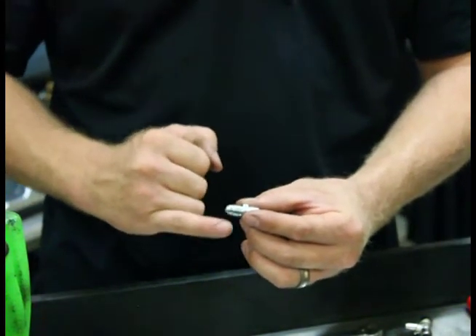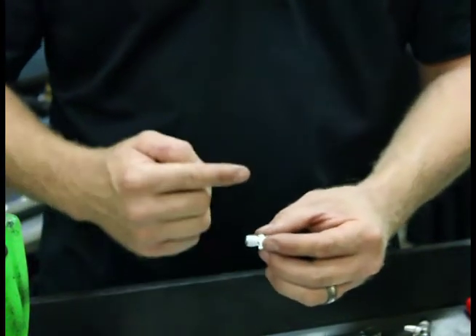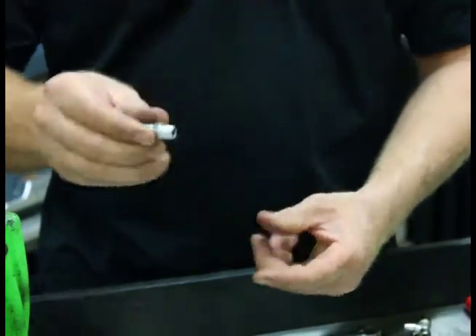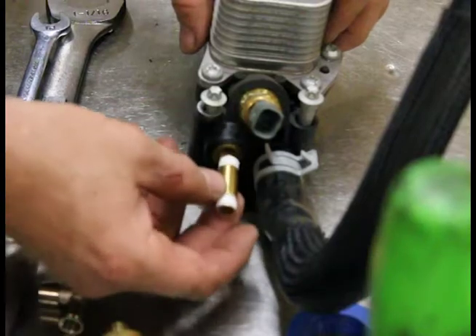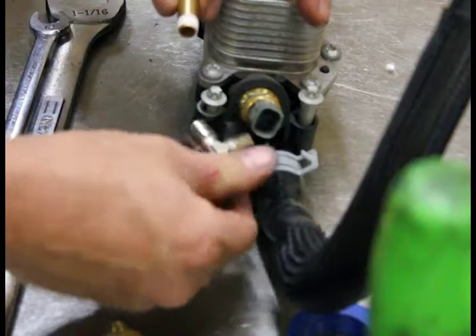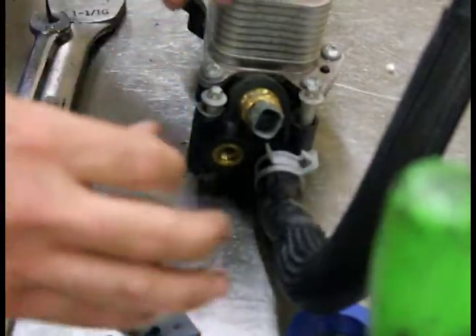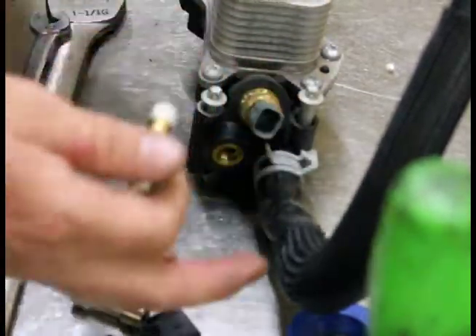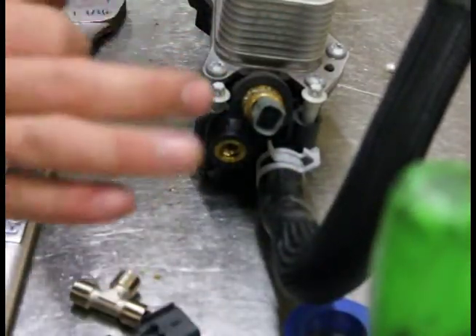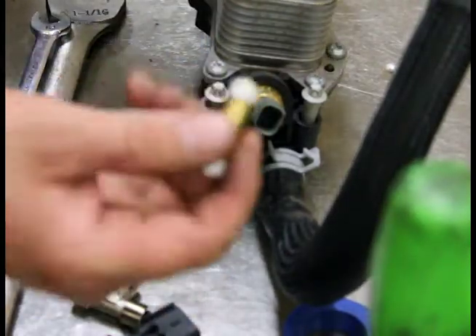So, pointers: nothing on the flare — ever, ever, ever. The seal is the flare. Male pipe thread — got to get it in the right direction, hold in your left hand, across the top. So let's do it. First one is the extension — it's going to bring it away so that when we rotate this we don't run into there. It's going to bring it back so we can put an oil feed line on — the right length, the right fit, no rubbing, chafing, no leaks, anything like that. This really was a great idea to take this out. But if you try to do this in a car you're on top of it — it just sets you up for a potential problem. Take it out of the vehicle, do it like this.